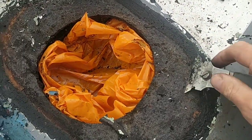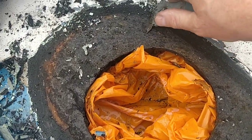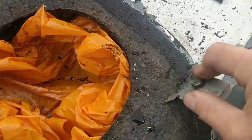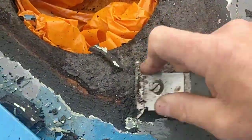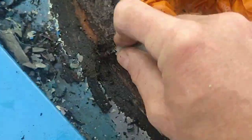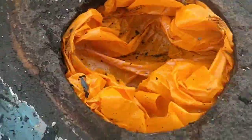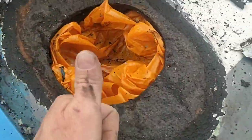I'm just scraping this old sealant off the roof here. I've already treated this roof rust with Kurust, which I got from Halfords — just like a tenner for a bottle. Before I put the chimney back in, I'm going to treat all the rust and scrape it all down and clean it off and stuff. Looking good so far.